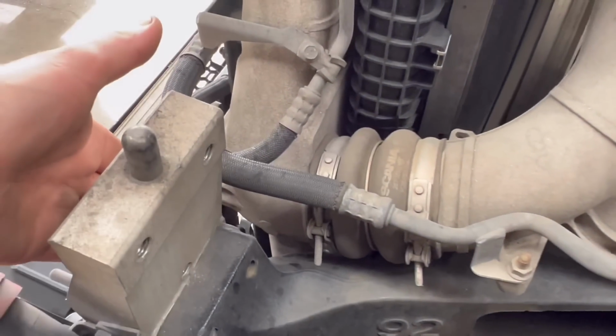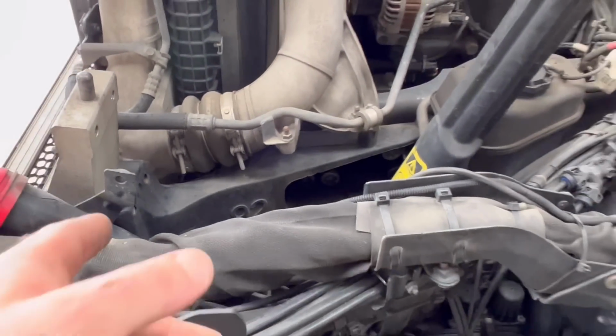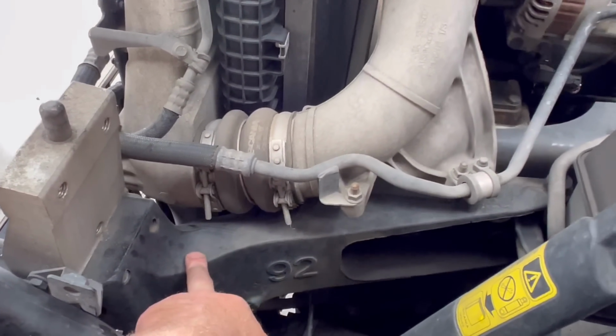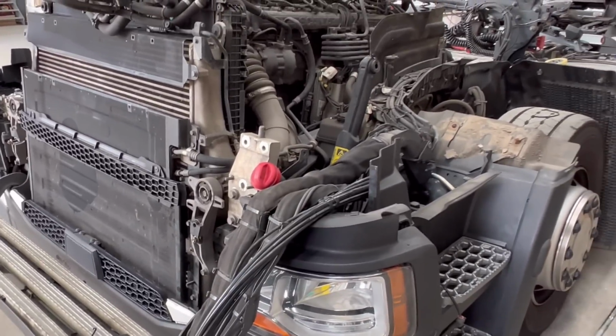As soon as you bolt the new one on, it's going to rock, because that's not level, that's bent back. The cast is very soft. You can easily drill in the cast, in the steel you won't drill as easy as in the cast. You put like a 6mm drill bit and it will go like in butter. So that's pretty soft. We're going to replace it all then.